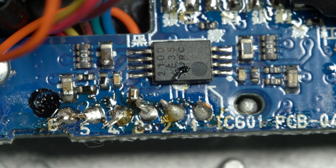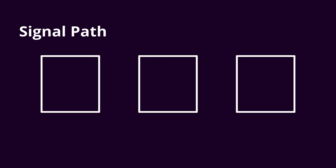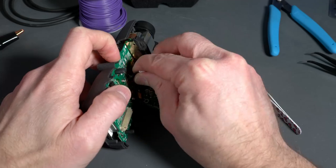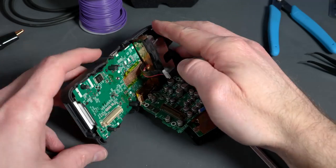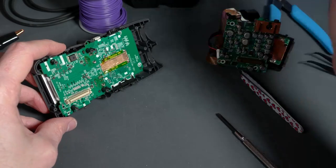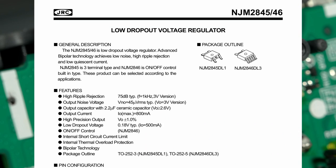On the microphone side, we see the NJM 2100 again being used as an audio preamp. In terms of actual workflow, the audio signal comes in, gets preamplified by the NJM 2100, and then cleaned up by the NJM 4580 before it's sent on to the ADC, which is the AK5357. Back to the actual unit — in order to access the next board, we're going to have to remove the little copper shielding strip that connected the top board, as well as the XLR input connectors, so we can remove the actual XLR connectors themselves and get access to this board. But once we do that, you can see that there's really not much going on on this board — the only thing really here is a voltage regulator, the NJM 2846, also made by New Japan Radio. That's just here to regulate the 3.3 volts that the other side of this board is probably going to need for its various power rails.